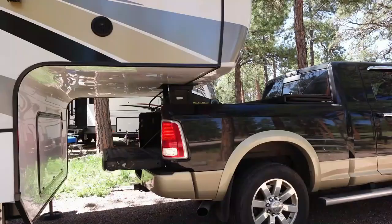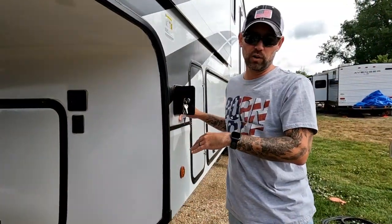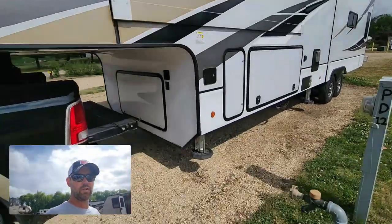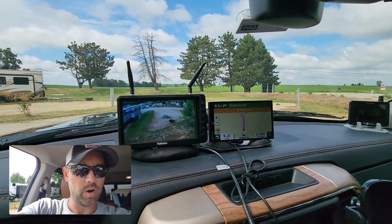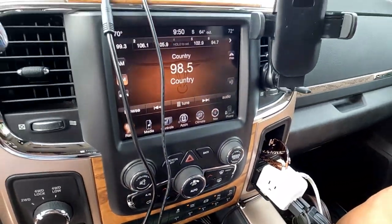Leslie is going to get me lined up on the hitch, adjust the height to make sure I'm where I need to be, then get out of the way while I back her onto the hitch. Once hooked up, retract all the legs and do a little tug test to make sure the hitch is engaged and we're not going to drop the trailer. Make sure the power cable is plugged in and the breakaway switch is hooked to the truck. Leslie checks the brake lights — good to go — then we unhook the power. Do a final walkaround: jacks are up, slides are all the way in, latches are latched, tailgate's up. Travel day cab setup: rear-view Halo View camera, Garmin RV GPS, TST tire pressure monitoring system, and our navigator. Last thing — make sure the tow-haul button is on, TPMS is working properly, plug in the GPS coordinates, and let's roll.